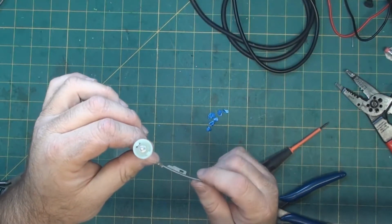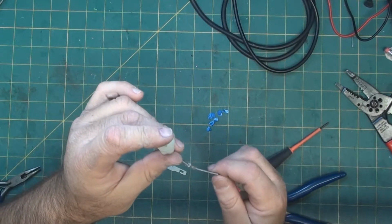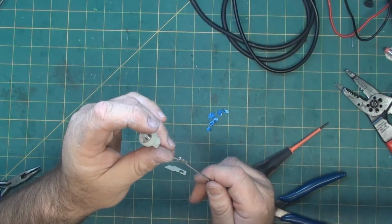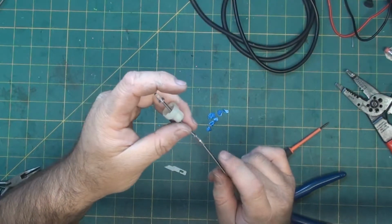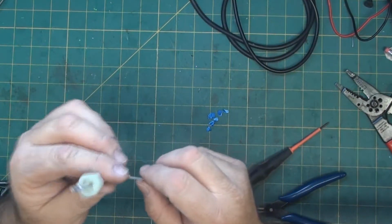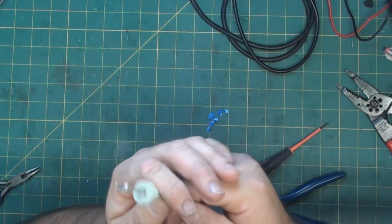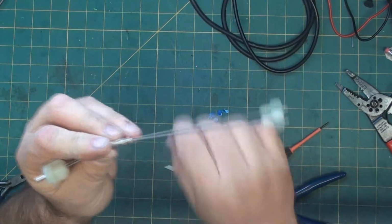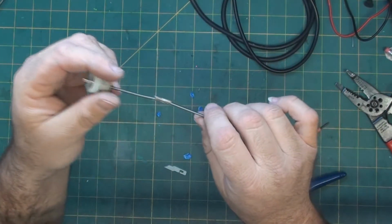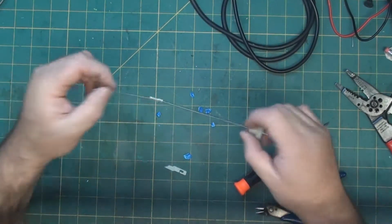It's not the best repair, but it is a repair that you could probably try at home. So before y'all try it at home, we're going to try it here and see if it works. And if it does, I'll probably drip some solder on here to seal the seam and prevent this from expanding from the slight bend it's going to have. Because over time, with temperature and use, there's a chance that might expand since there's no plastic sheath on it anymore to help keep it tight. So I'm going to reassemble the house with this in it, and we're going to plug it in and see if it works. So I'll be back momentarily.